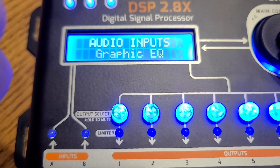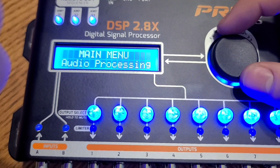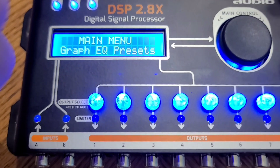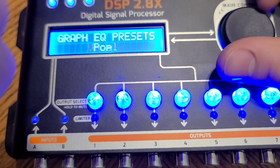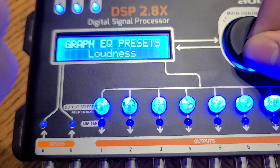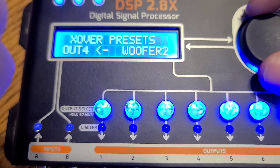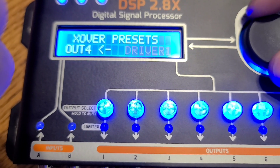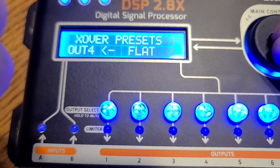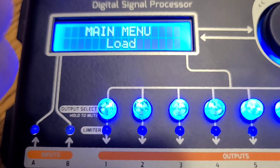So we're back at graphic EQ — we'll go back to run through the remaining menus. We have graphic EQ presets: flat, loudness, bass boost. A lot of people don't really use these; I like to leave it on flat and let my tuning do the work. Then you have crossover presets, which come in handy as a good starting point if you don't know where to begin — different subwoofer settings, different woofers, mid-bass drivers, one for titanium, one for phenolic, and then a tweeter. You can save all your settings and come back later to load them, so you can have multiple tunings — one for battles, one for sound quality. The copy channel feature lets you copy everything set up on one channel to another, choosing a source and destination, so all your work on channel one is copied to channel two.